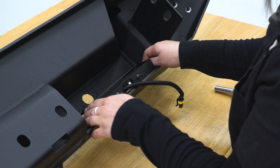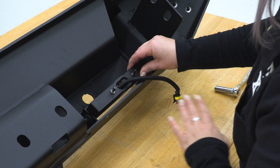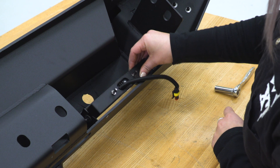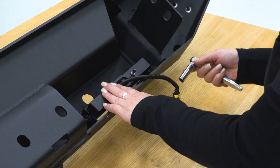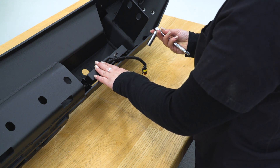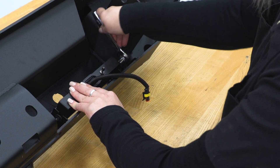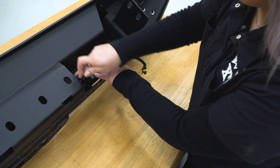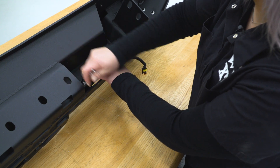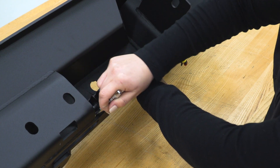The U-bracket is going to go on the inside of the bumper bracket, but the flat washers are gonna go on the outside. What I do like about this in comparison to the JK model of the XRC Gen 2 rear bumper is that you're able to angle these and they are on the bottom here instead of the top. So what we're gonna do is just tighten those down, making sure that they're angled properly. We're gonna evenly tighten those down with the same 10-millimeter socket. After our one light is on, we can repeat that process on the other side.